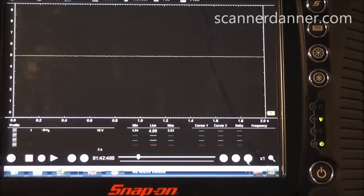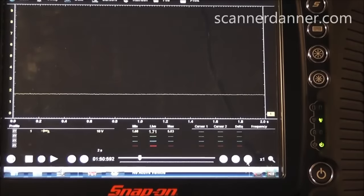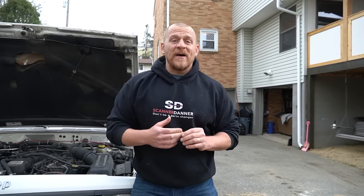Here's a quick clip of a shorted MAP sensor and what it looks like when you unplug a sensor that is actually shorted and pulling the reference down. I'll show you one more time plugging the MAP in — as soon as you plug the MAP in, it shorts the reference out. That gives you insight into how highly protected these reference circuits are. That video is linked in the description and there's a card above me if you'd like to watch it — it was on a Honda Element with a shorted MAP sensor.